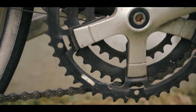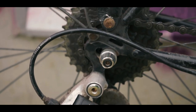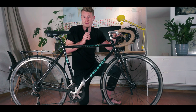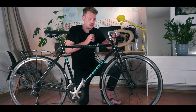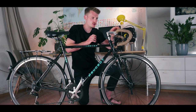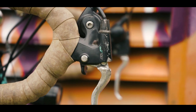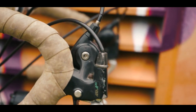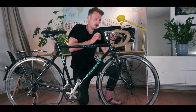In the front we have a triple chainring, in the rear we have a seven-speed cassette. The smallest gear ratio on this bike is a 28 in the front and a 32 in the rear, so nice undergearing for climbing and carrying loads of stuff. This conversion — originally these were Shimano Altus flat bar shift and brake levers, but I flipped them 90 degrees and now they are vertically orientated as you know it from race bikes. It works quite good.